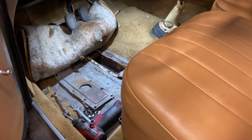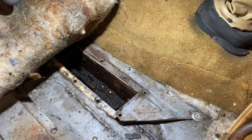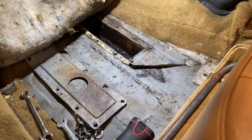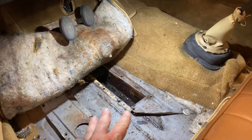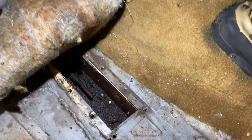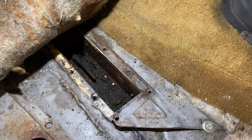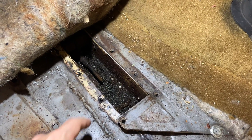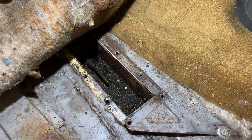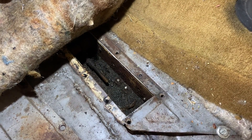The master cylinder on the Morris Minor sits within the frame rail. I had to remove the bolts that hold the seat down, pull back the carpet, take off the cover over the master cylinder, and then remove all the lines and bolts going through the master cylinder. As you can see I still need to clean out this cavity — that is years and years of brake fluid and junk that has gotten in there.